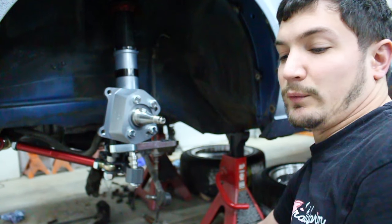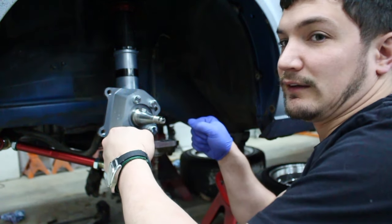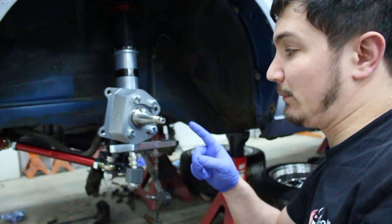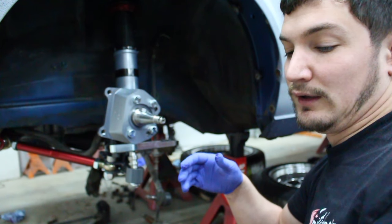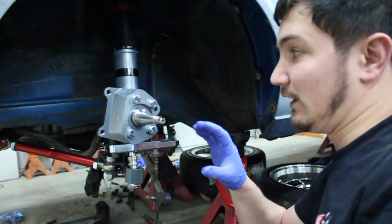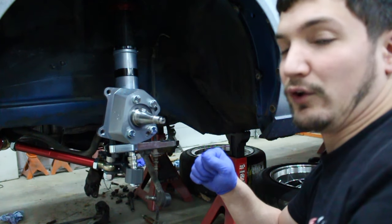As you just saw, we pre-built the hub — I put the bearing and the seal in the back, which allows us to slide this on quickly. After that I'll put a little more grease inside for plenty of cooling for the bearings. Then we'll slide the front bearing on, the nut and retainer, and the hub will be on with the new brake rotor. After that we'll put on the new caliper.